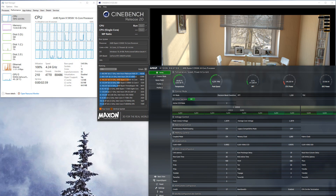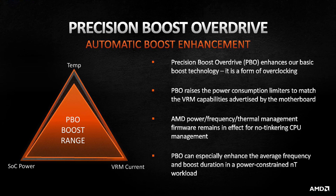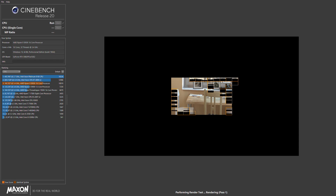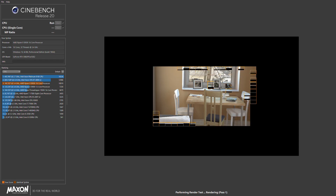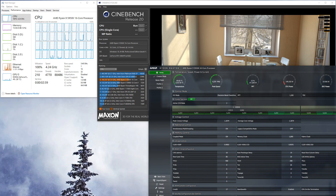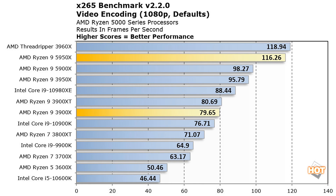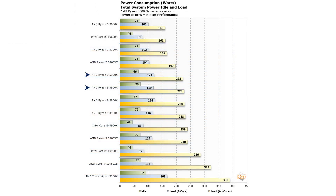Let's look at performance. This machine is seriously quick. A run at Cinebench R20 shows the CPU at 100% load, and in PBO — Precision Boost Overdrive — we see an all-core boost of 4.25GHz in Creator Mode. My Ryzen 9 3900X used to score 7,230 Cinebench points, but now we're pushing over 10,800 with four more cores and the IPC lift of Zen 3 over Zen 2 — a 50% gain in multi-threaded rendering throughput. 3DMark Firestrike's physics test shows about 33% more gaming performance, and the x265 benchmark shows over 45% more horsepower for encoding 1080p video. All this extra performance comes at slightly less power consumption, whether at idle or full load.